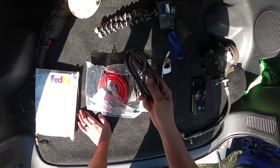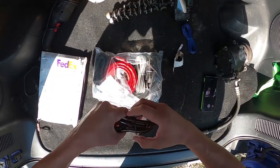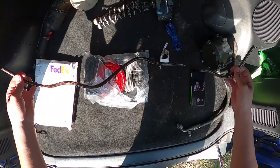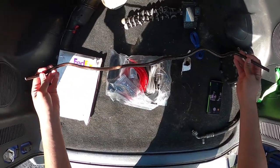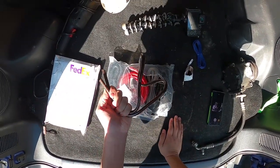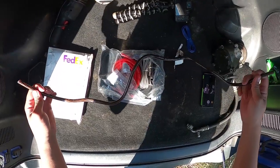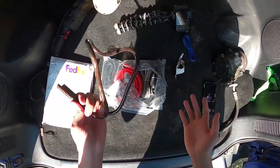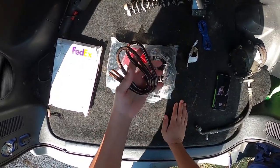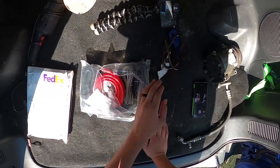This little brown wire here is really short — the ground wire is always a short wire because you don't really want anything longer than about two feet when you ground your amp. You want it grounded close to where your amp is mounted. The longer the ground, the worse the connection, so you always try to use the shortest ground you can. That's your ground wire.